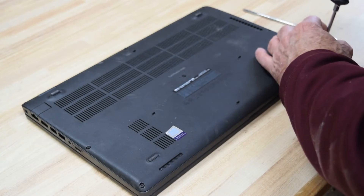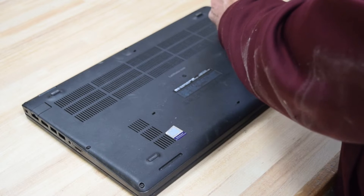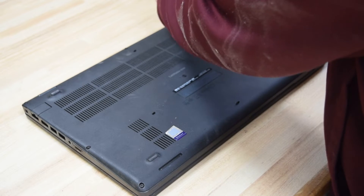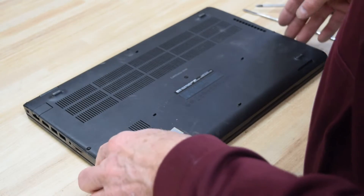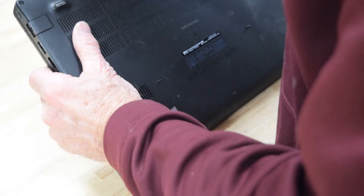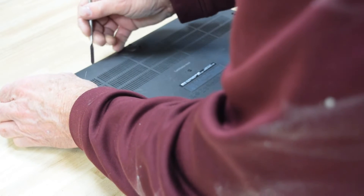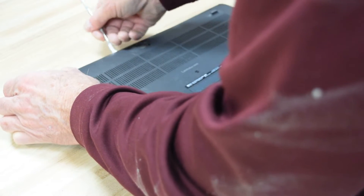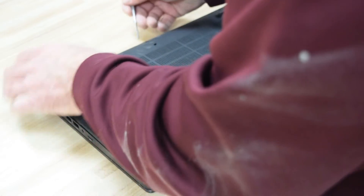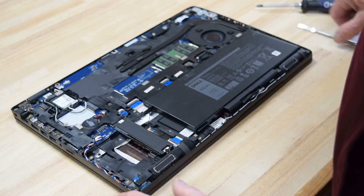Sometimes the battery will be so bad that it will push up — it will actually bulge and push up on this bottom plate and you can see the battery bulging. Once you've done that, once you've undone the screws, you just simply pry the bottom. It's held in by a number of plastic clips. If you start in one corner and give it a gentle nudge, it'll unsnap. Work it about halfway down the back, get your finger in there, and gently pop — the whole back will come off. Just be careful you don't break the tabs, but they're pretty tough.